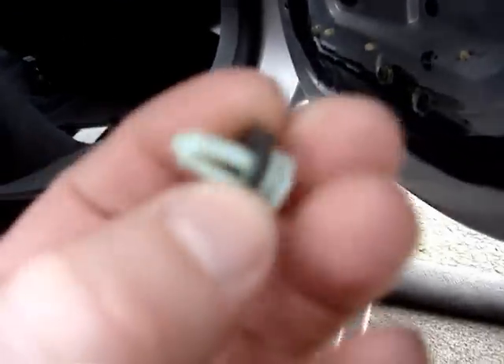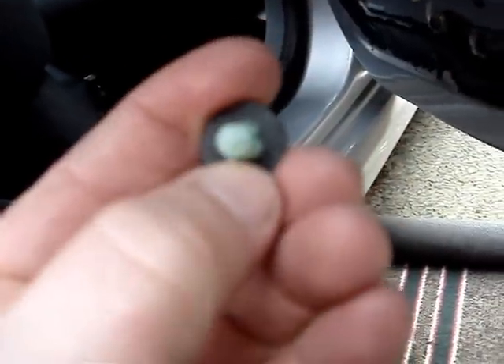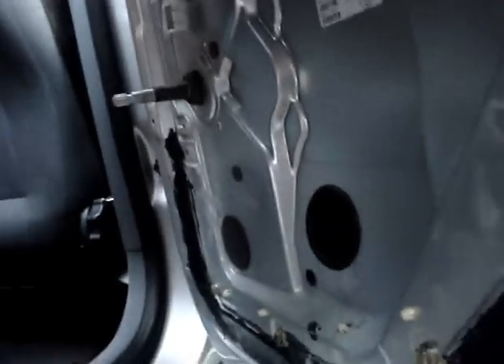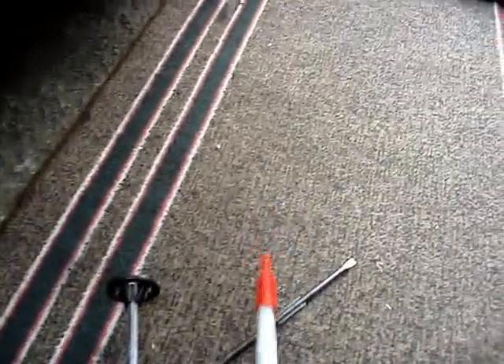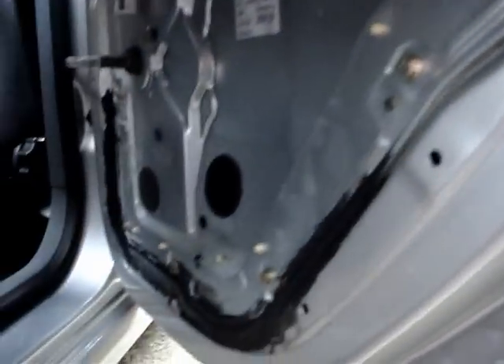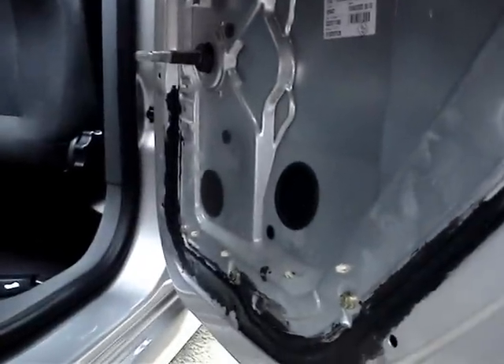These little catches - make sure you could break them, so you'd be advised to have a couple spare before starting. Make sure the rubbers are back on them when you insert them back into the little carriers, so all the rubbers are on all the catches. Now that panel's ready to go back on, and it's just a matter of the reversal of taking it off - handle, screwing it all back on. And that's an easy fix, really, just for the price of the sealant. Hopefully this helps anybody that's having this problem, because it's quite a few Fabias, I think. Bye.